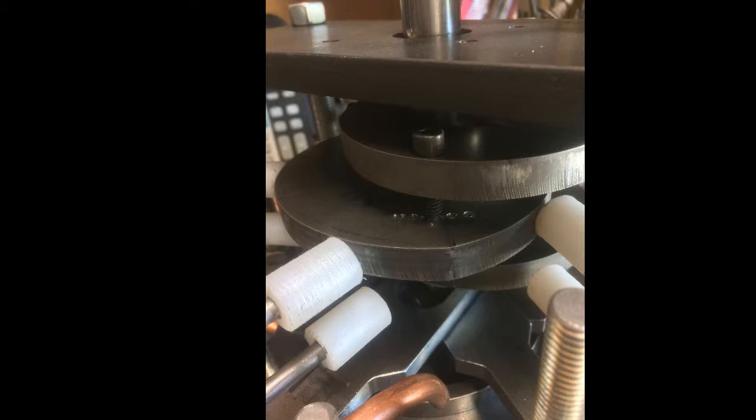This is the way the cam system works — it's got three cams. The top cam is just an adjustment for timing, the center one is the intake, and the bottom one would be the exhaust valves. Looking at it from the top, the camshaft rotates to the right, or clockwise. If for some reason the engine tends to run backwards, the lump on the center cam and on the bottom one won't let the white slider slide because of the angle it's at, and it ends up just bending the valve when the camshaft turns backwards. So that's no good.